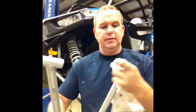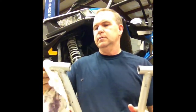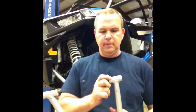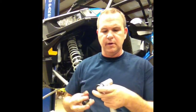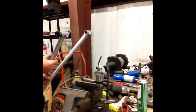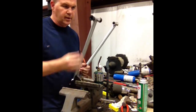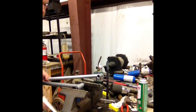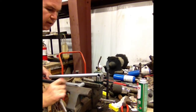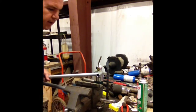I'm actually going to wipe the lube out of here. Now these bushings are designed to be pressed in — don't beat them. You can damage them with a hammer or whatever. What I'm going to do is get them started and then show you how I do it on a vise. Just basically get them started with your hands and then move to the vise. It wouldn't be a bad idea to put a rag in there to keep from scratching them. Press it — it slides over one side and then goes to the other. Don't put too much pressure on it; once it's bottomed out, just stop.